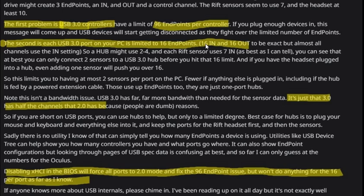You also have to be aware that a lot of equipment and accessories use both in and out ports. So it's not like 32 devices or even 16 devices, because a lot of sensors and equipment use more than one endpoint. For example, a hub might use two to four, and an Oculus Rift sensor uses seven endpoints. A lot of headsets use up to seven endpoints, so with multifunctional equipment you use up endpoints really fast.